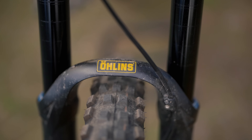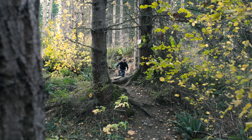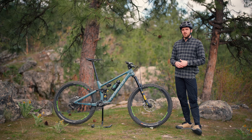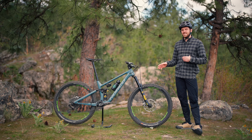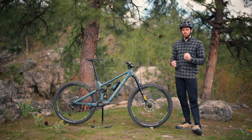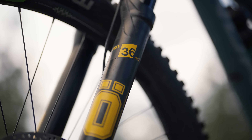So how does this fork feel and perform out on the trail? In my humble opinion it makes the bike really lively but still gives you confidence when things get rough. I like the fork to be really soft off the top and hammer really hard at the end of the stroke. Comparing it to the DVO Onyx or a Fox 36, it's right in the middle — it doesn't have the harsh feel I find 36s have off the top, but it does have that nice DVO softness. As far as ramp-up goes, it ramps up better than the Onyx but not quite as good as the 36. With volume reducers you get a little more tactile feel, but with this air chamber it really just guides you to the end of the travel, which I'm becoming a big fan of.